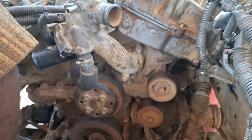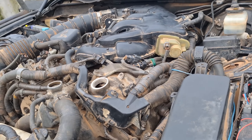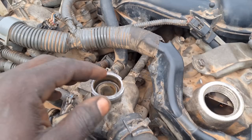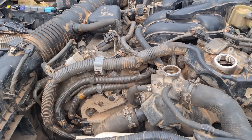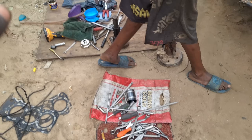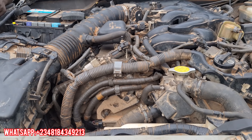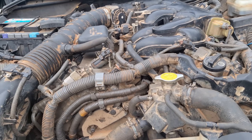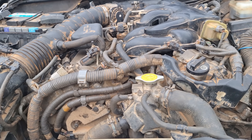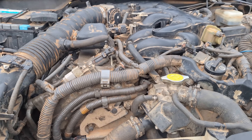We're installing everything to make sure the job is clean, then we'll start the car and see if it's no longer mixing, then go for a test drive. This is day two and we've rounded up this repair — everything is assembled. We're about to start the car. We won't put coolant in yet; we'll try to start the car first to let the gasket shellac dry up. These are the gaskets that were changed. It's going to do a bit of a delayed start and rough idling before it actually works because the whole thing was taken apart.